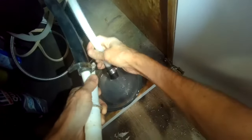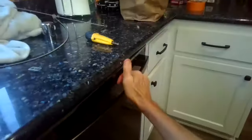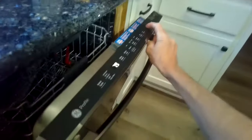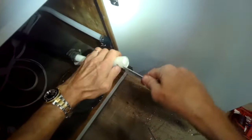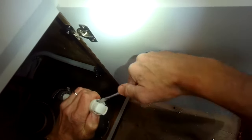Then some water is going to come out. I'll set it to drain and let the water come out into that bowl — a lot of water may come out so be ready; you may want to use a bigger bowl so it doesn't overflow. Water is shooting out pretty good, so definitely the obstruction is gone. I just want to check though — I'm going to pull that cap back off again and see if there's anything caught in there.